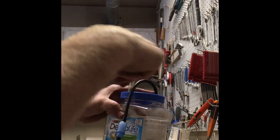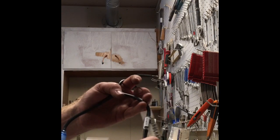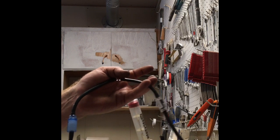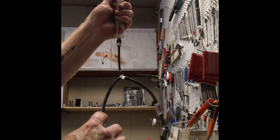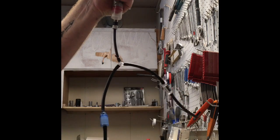How it works: you've got these two aquarium anti-siphon valves — they only let air through one direction. This way goes out that way, and this one comes up this way. They need to be going in opposite directions so that when I pull the syringe back it pulls air through here, and when I push it down it expels the air out this way.